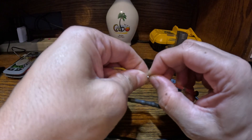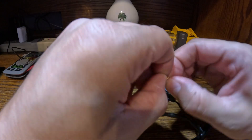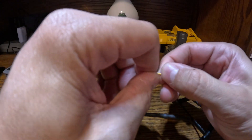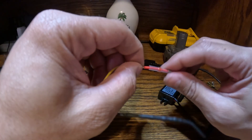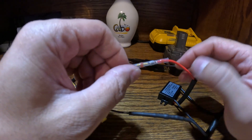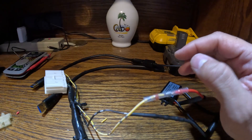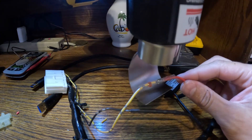I'm going to do the same thing on this one — just find the middle point of these two wires, wrap one end, and then come back and wrap the other end. This makes a really nice solid mechanical joint so they shouldn't come apart — even just doing that much they're on there pretty tight. Then get this solder seal right in the middle of both of them. I like to make sure there are two little red seal holes on the end, and when you heat them up they really stick.